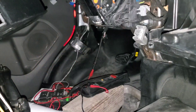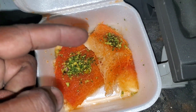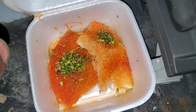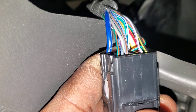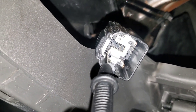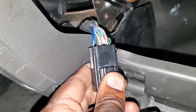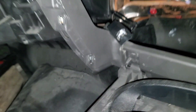I'm connecting with my multimeter to the gray with blue at the CAN gateway. I decided to test on the second pin — the gray with the blue — and we've got our network. I've got to see if there's any other connector from where this network goes that's not connected, but if not, there's a problem right there.